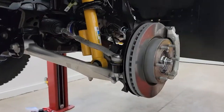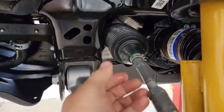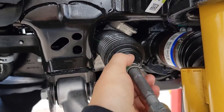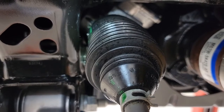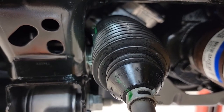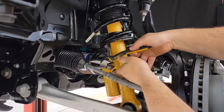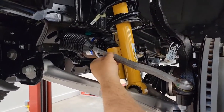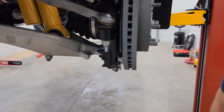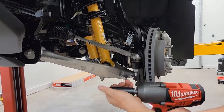Okay, let's set this aside. Next, we're going to take off this and loosen this up with a few taps of a hammer. We're going to take this clamp off, pull this, loosen that up, pull this in — and you can see this clamp right back in there. Let me get a little light on there. You can see that little dog ear on that clip — we're going to hit that with a screwdriver to knock that loose. So we're going to take off this clamp right here. Get yourself a big pair of pliers. This is a 21 in this instance, but these can be different sizes. Let's take this off — make sure it's going to the left. That was easy.